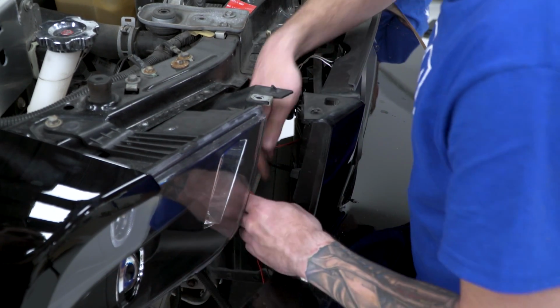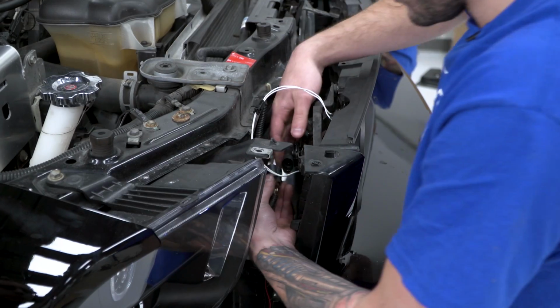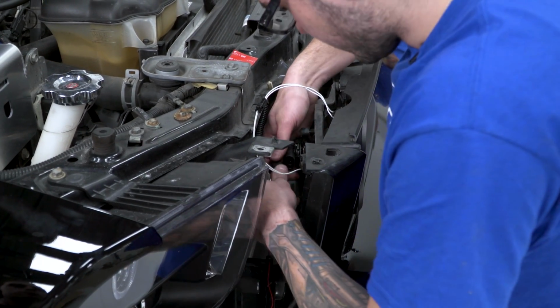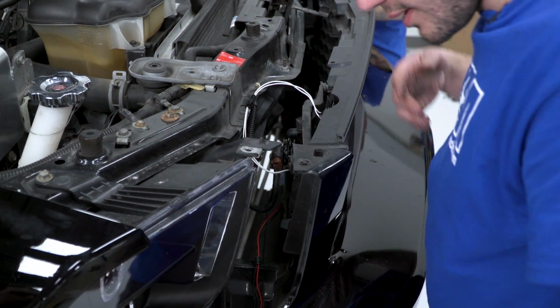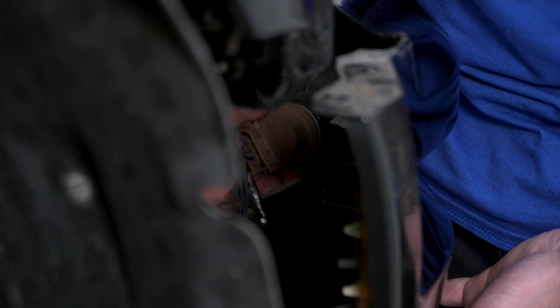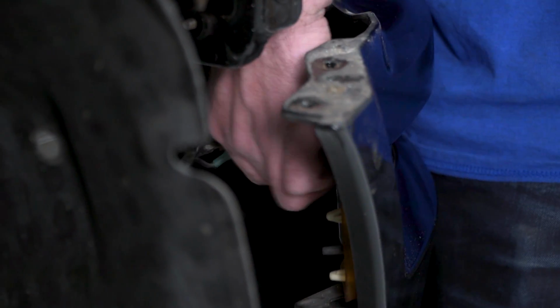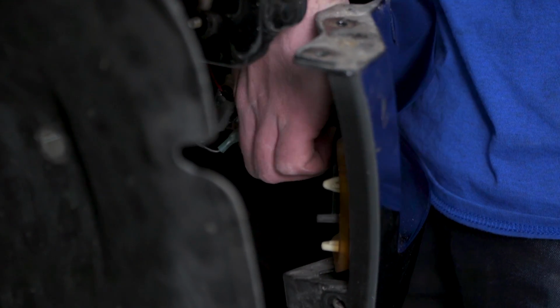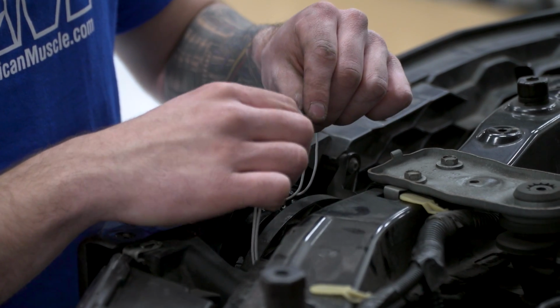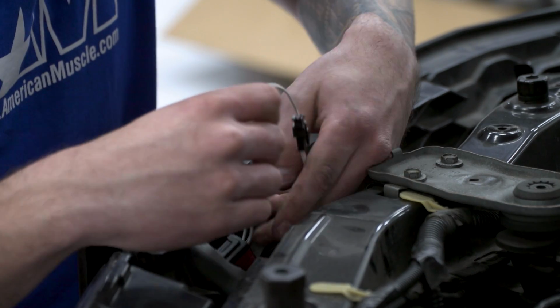And from there, you take your harness, plug in all your wiring. Fog light bulb connects straight into the factory harness. And then you can put your parking light right back into place. Turn signal bulb's going right back in the same spot. So now your parking light bulb, the one that we did all the splicing work to, will twist right back into its factory housing. Opposite side here, same deal, connecting our Raxiom harnesses together, the ones that we spliced.